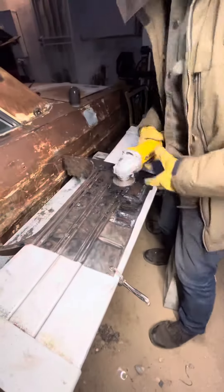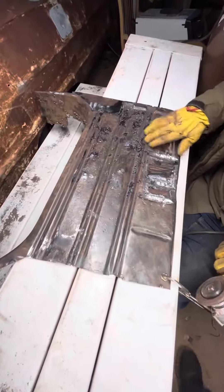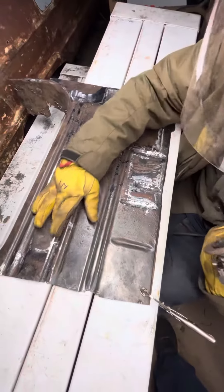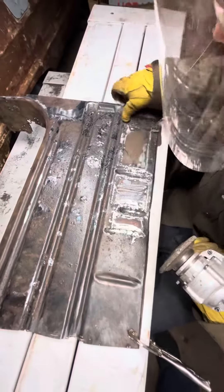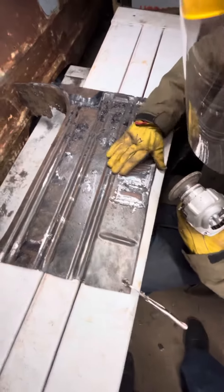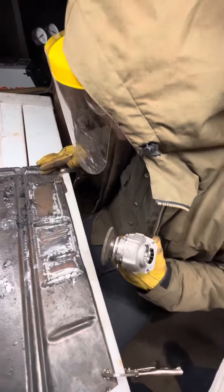So what are you doing, Josh? Right here, we welded inside of these beveled edges. I don't want to have to throw Bondo on these, so I'm taking the time to grind these into the proper original shape that they were.